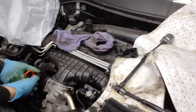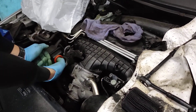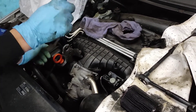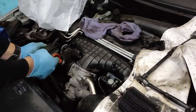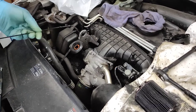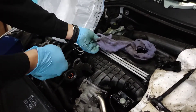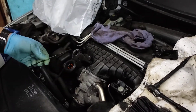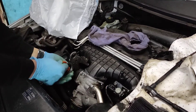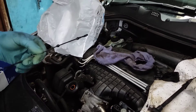Let's check the dipstick - very easy. If it doesn't want to come out, don't pull it. You can see it's already broken by someone pulling it. Put your index finger and just twist to the left. Let's see - it's already on the dipstick, that's good. I don't remember what the capacity of this motor is, but I know I need to buy five liters of oil. It's right to the maximum.